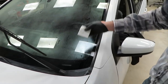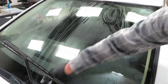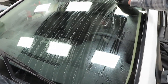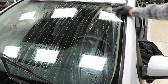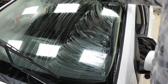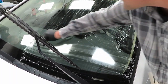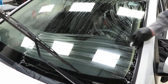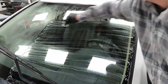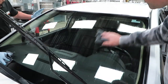Moving to the glass coating — starting with the glass cleaner preparation wipe. We just want to work this solution into all of the glass imperfections, the micro-pitting and scoring that might be in your glass. That could be dirt, road grime, or particulates from your windshield wipers that can get stuck in those. We want to make sure our glass is really, really squeaky clean before applying the ceramic coating side. Ceramic coating is long-lasting, so anything you don't get out you're going to seal in and it won't be easy to repair. Preparation is key to a good final result. We want to rinse it off really well — normally with an open hose — and dry it off thoroughly. If you have compressed air, use it inside the channels and gutters of the window.